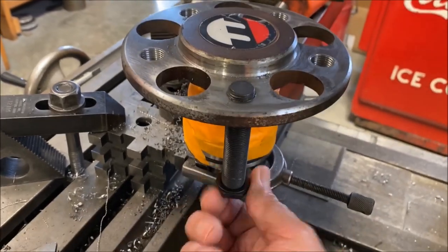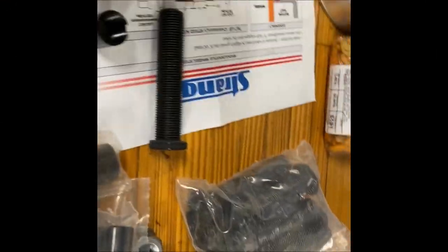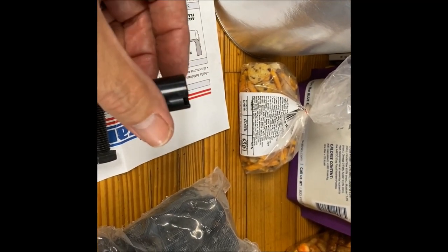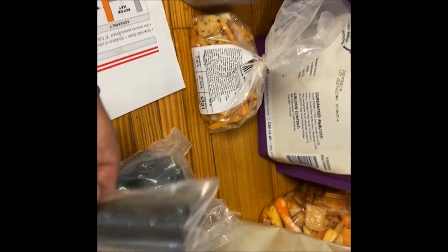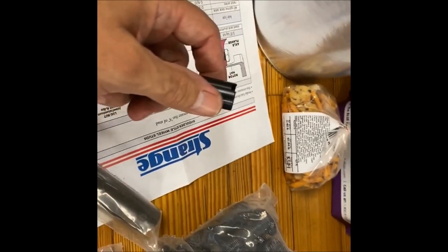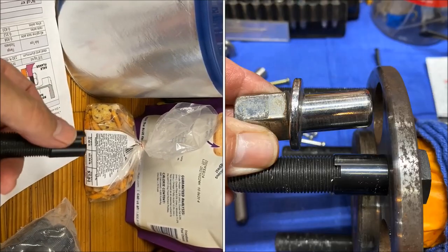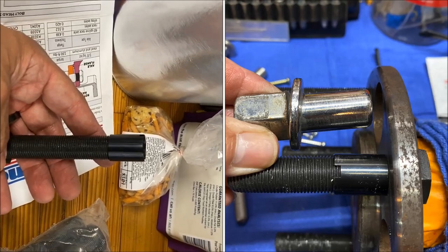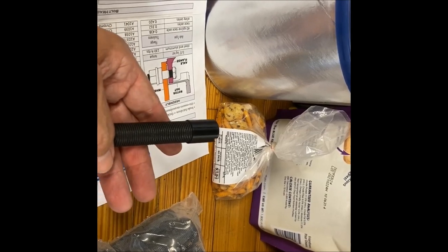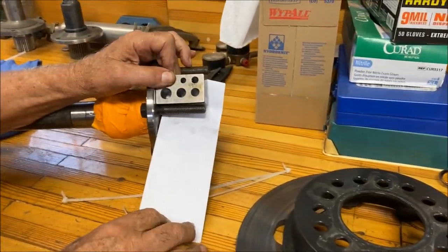Works like a dream. Here's the stud — the three-inch stud — and this is the sleeve that goes over it. You have to have a special tool to tighten that up, and it comes with it. This thread insert screws over the stud and then fits inside the center of the wheel to take up that extra space. It's pretty unique — you don't have to buy wheels that are 5/8, so you can kind of convert. Now we're getting ready to pull the studs out of the old axle; they're half inch.